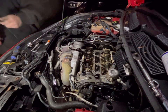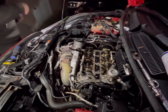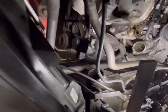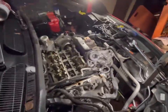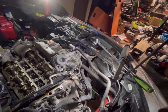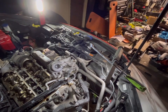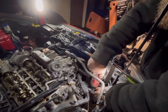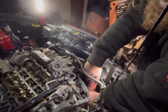Next up what I'm going to do: the water pump is at the top right, right there. I'm going to take off the three 10mm bolts there and then that will slacken off the poly-vee belt. I'll try and find a decent position for you to sit. One, two — bob those there a second.